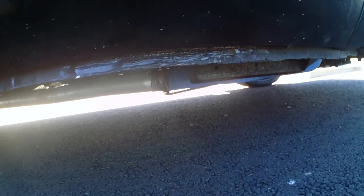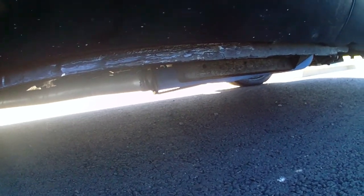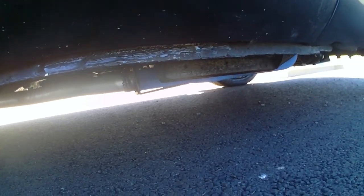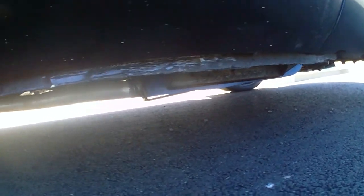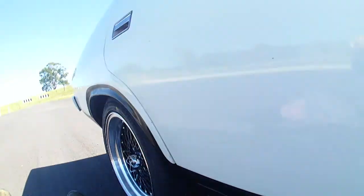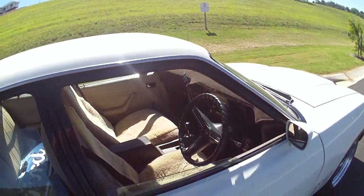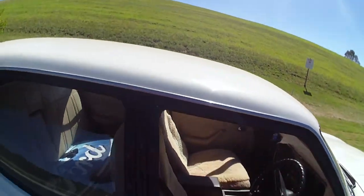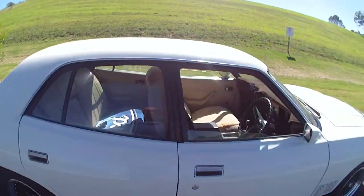The first few XB GTs ran a lot of Phase 3 stuff in them — only very few though. The Australian Muscle Car magazine has done a lot of research on them, and they would run what they call the white stripe top loader, bullnose top loader. You could spec them up to the big axles — mine are 28-spline, but you could spec them up to 31-spline.